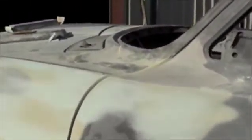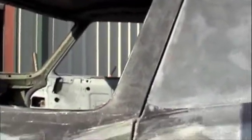We've gone through the body lines that were there previously and laid them all out at a 3/16 gap line, so you can run all the way down the gap line and get a real nice even gap down through the side. Then we're going to be doing the same back here, carving out the gap line and getting it to an even line for when we go to do paint. And just getting the body all back. This was the worst side of the car on the front. I went through and got the lines real nice and evened everything. Like I said, I put a nice even coat of metal glaze across it, and we're going to be going onto the roof in the back quarter area and up on here and getting this all laid out today.